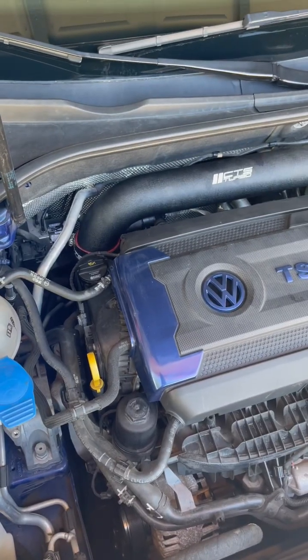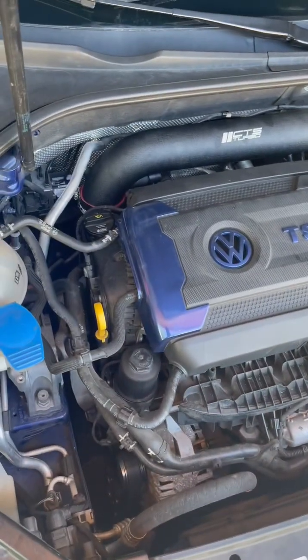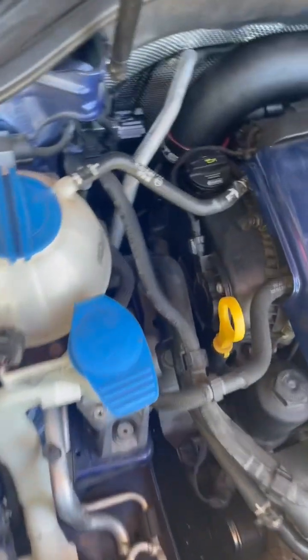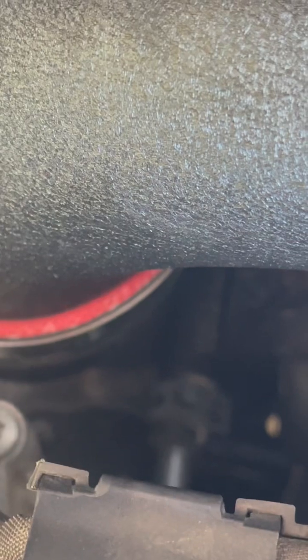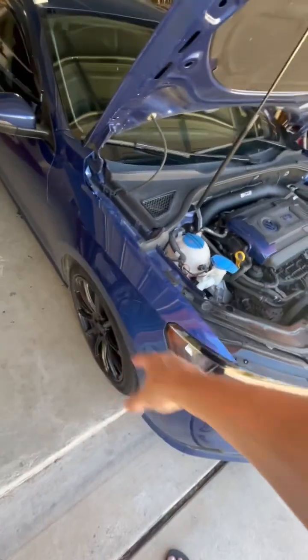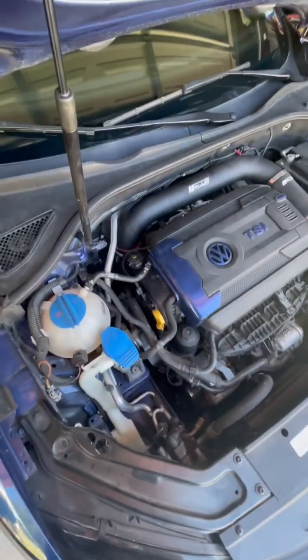Everybody will tell you, go ahead and do the diverter valve. That will fix it. But yet I know a bunch of people online with Passats that say it did not fix theirs. And the other thing is, the diverter valve on this one is... Where is it? Is that it right there? Yeah, see that? It's in there, man. It is really in there, and it is not easy to, you gotta lift this whole thing up and take the wheel out and take the fender liner out and sometimes loosen the, no.